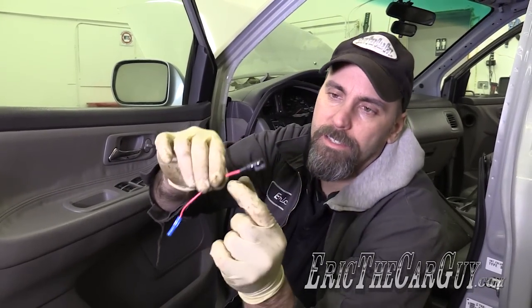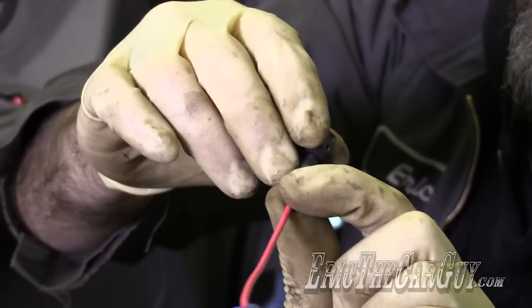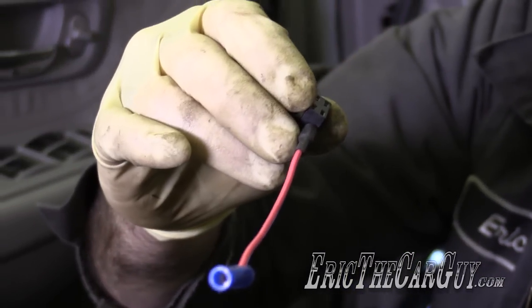I've looked at both interior fuse boxes inside the 2001 Odyssey and I can't find any open slots that are ignition hot. Any open slots I did find don't have any power or ground or any provision to add anything, so I can't tap into the fuse box directly. I was a little disappointed to find that. However, I did find a solution at the auto parts store - an add-a-circuit wire that plugs in in place of an existing fuse and allows you to fuse a power output.